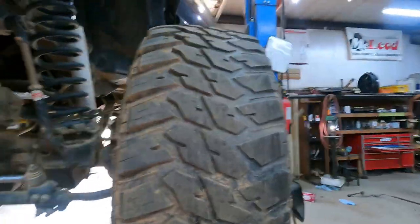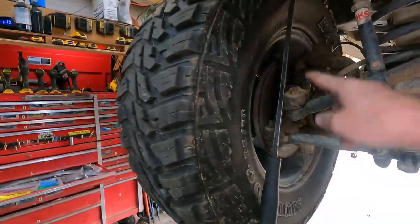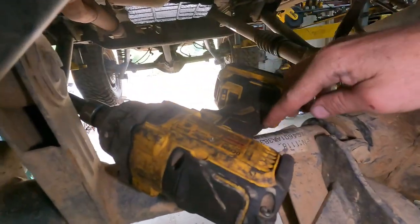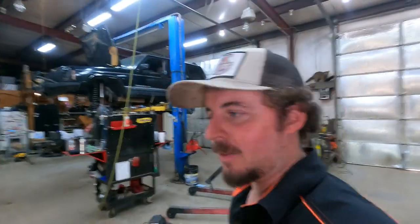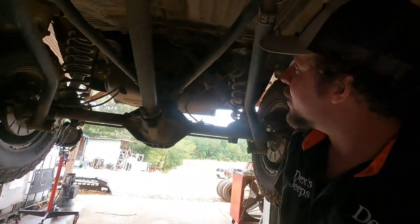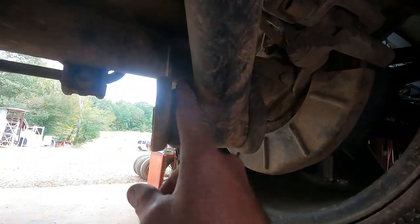It's gonna need both wheel bearings. It's got quad drive in the front and I still haven't figured out the ratio — probably factory 3.73. Somebody spent four thousand dollars on a long arm but didn't put gears in. The rear end is welded — if it were a full off-road build that'd be cool, but I don't really know what I'm doing with this Jeep yet, so we'll deal with that another day.